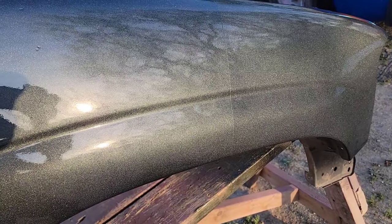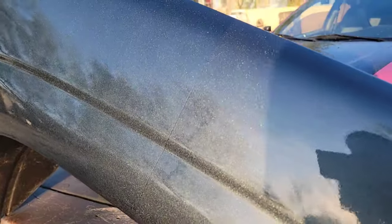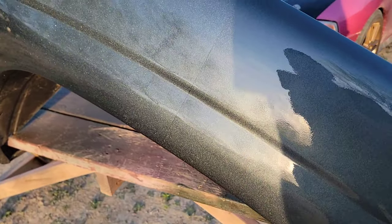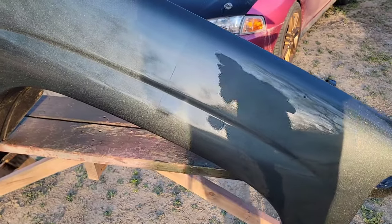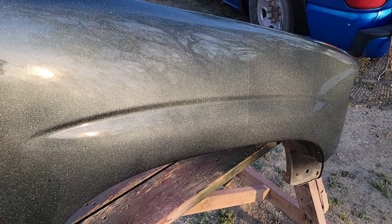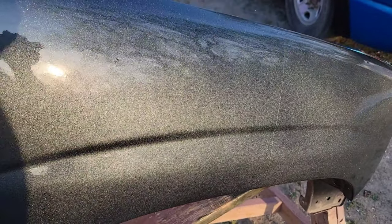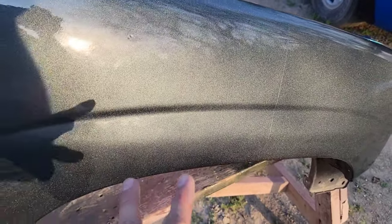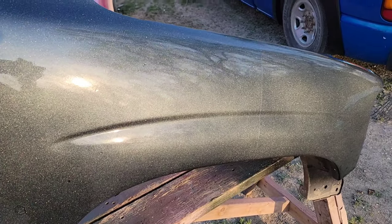The pearl, it's called black pearl, over black Rust-Oleum. It was just like a teaspoon for about 150 milliliters for this fender. I sprayed 2 coats and I did the flow coat off camera, just to spray it till whatever was left. It was a second coat, just a control coat, spraying everything.